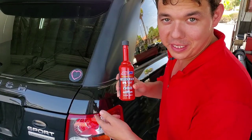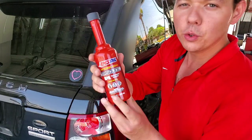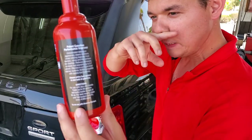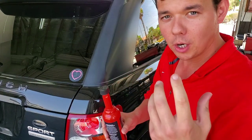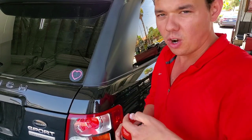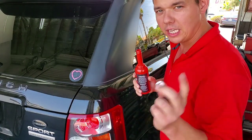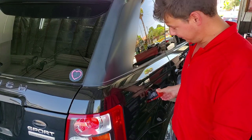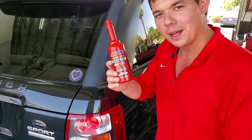Now while she's idling for 15 minutes, we're going to put in our PI Performance Improver. This is a fuel system cleaner — you put it in every 4,000 miles and it treats 30 gallons of gasoline. This cleans the valves, gets all the carbon deposits off so the valves seat better. You also get a lot of the carbon out of the combustion chambers. The combustion chambers actually change shape over the years as carbon builds up. Well, this gets it off in about five gallons flat. All we do is stick her in and give her a little shake. This goes in every 4,000 miles.